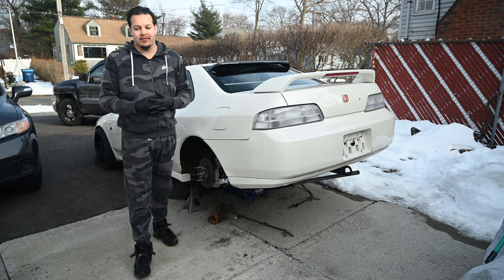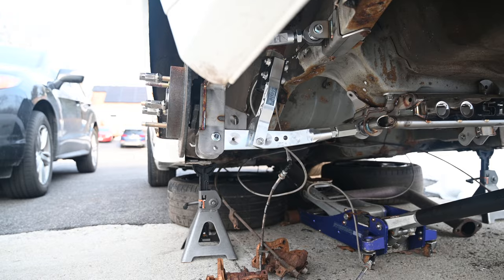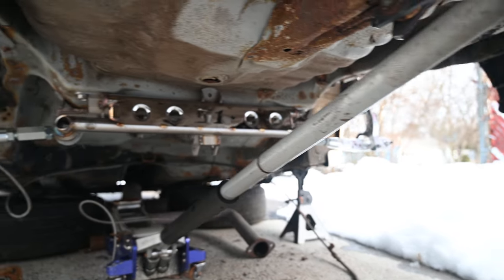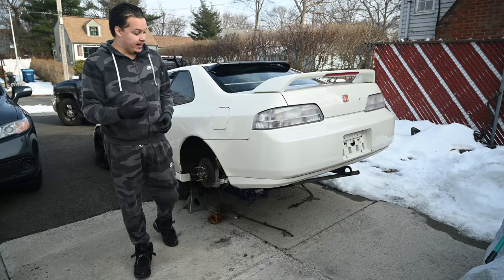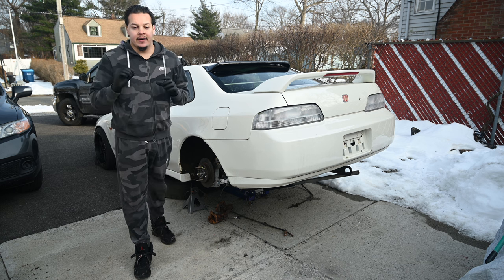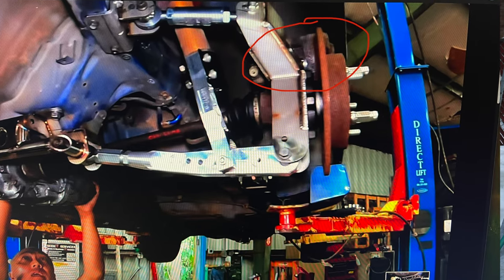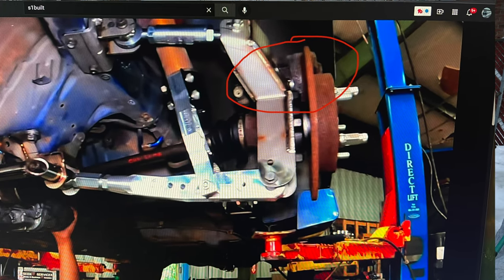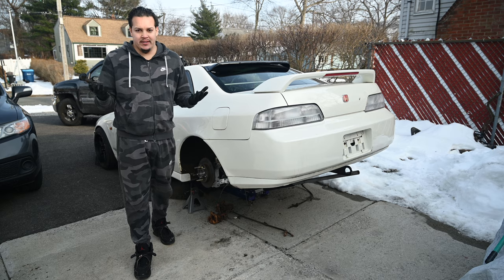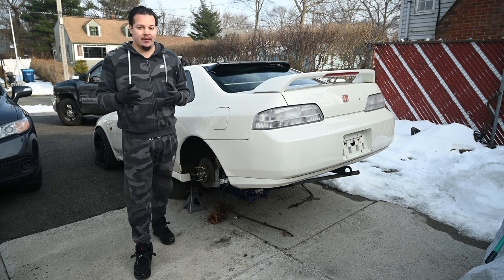All right, that's what we're going to call it for today after a few setbacks. We got most of it mounted up. It would have been nice if this bolt-on kit included the actual bolts to bolt it on, because none of the factory Prelude ones worked and I had to get some Civic-size suspension bolts from McMaster to mount everything up. The caliper thing was also weird because I didn't see in any of their videos a spacer or bracket adapter, nor was there any hardware in the box suggesting there was one.